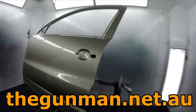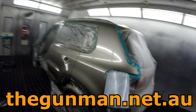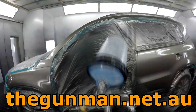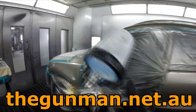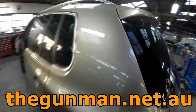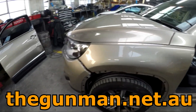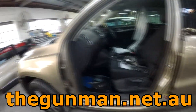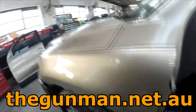Definitely a win. It's great to be working in a good workshop again. Yes, the booth may look a bit dirty but you can still achieve some really good results. We've got good suction in here and heat too. I'm going to go clean the gun out, give that five minutes to tack off, and then hit the bake button - give it probably a 40 minute bake at 60 degrees. I could include loads more info and I will in the future, so make sure you stay tuned. Thanks for watching, and this has been another Gunman production. Goodbye.